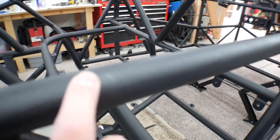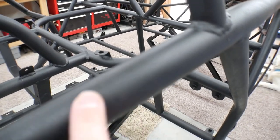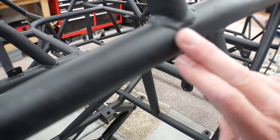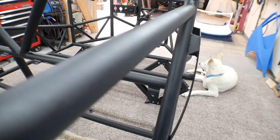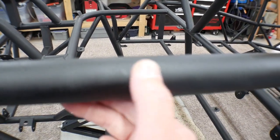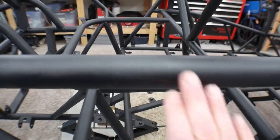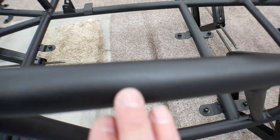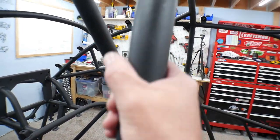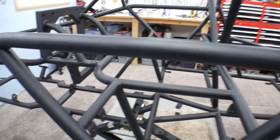So when you do it with the brush, the finish isn't bad, but you can see it's a little bit harder to pick up with the camera here, but you can kind of tell that at this section I was running the brush this way. Same thing with, yeah, I think that's better. You can see some brush marks, and really the reason that you see them is there are some differences in the thickness. So where it's a little bit thicker or a little bit lighter, you can kind of see the brush strokes. If I left it like this, I probably wouldn't be really, really happy with it, because if somebody walks up in the sunlight, they're going to be able to see these brush marks, and it's not the end of the world, but you don't want that.